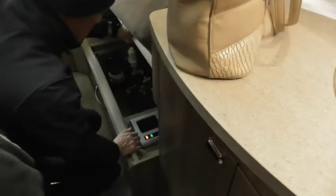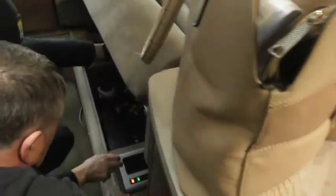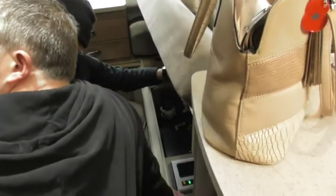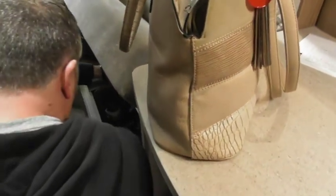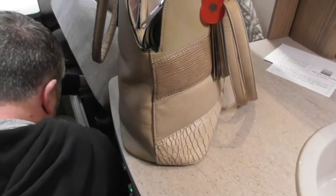We'll just have a look at the consumer unit, because that will be slightly different from your Bailey - it's got a couple of extra switches on it. Consumer unit hiding under your bunk. Heating and hot water - on your Bailey you may not have had an on/off switch for your heating system. If we look at the top right-hand corner, there's a heating system switch. If that is not switched on - or you obviously haven't got electric connected, or the bollard's tripped - that little plug icon will disappear. If that plug's not there, you're not operating on electric.